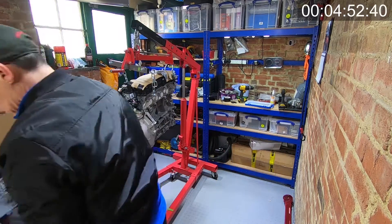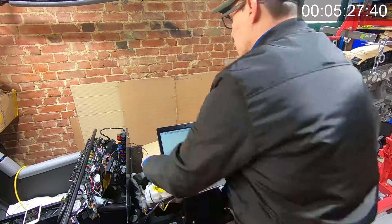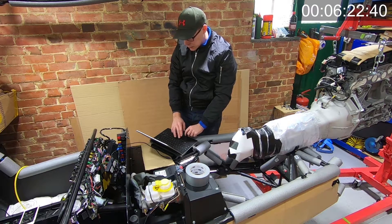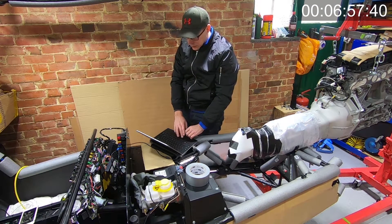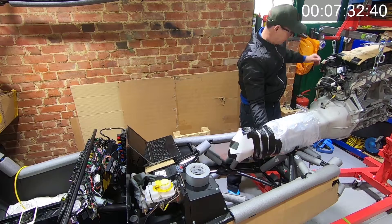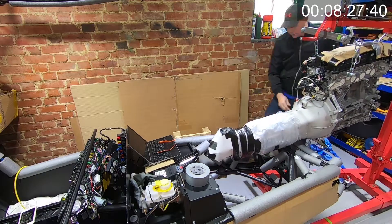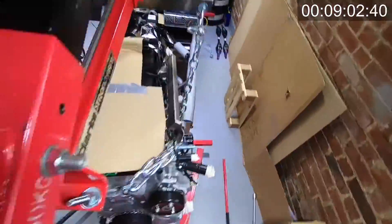You're most probably wondering what I'm doing with the laptop when we're meant to be installing the engine. Well, this is where my geekiness was shining through — seeing that I was doing this all by myself without any assistance, I came up with the bright idea of installing a GoPro camera in the tunnel and live streaming it to my laptop, and this would be my second pair of eyes in the tunnel. One thing to note: even with the leveler wound all the way to one end, the engine will not be level, as the pickup points on the engine are designed for the engine without the gearbox attached. During the final stages, you're going to need to use a jack to get the engine and gearbox into the correct location.